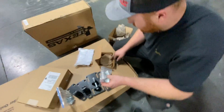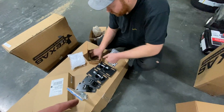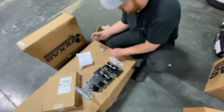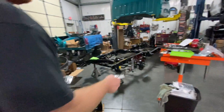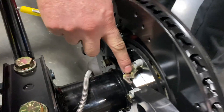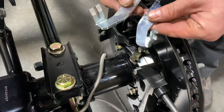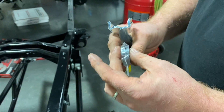Little Shop sent us our brake stuff as well — those guys are awesome. We were missing some parts from the kit. One of their guys sent them USPS and said they wouldn't be there until Saturday, but they actually overnighted one via UPS so we'd have them today before the weekend. They sent us the newer style e-brake handle — the one where the cable slides in. You cut your cable and add a new stop because the length is different from the drum setup. Big props to Little Shop for getting those to us quickly.